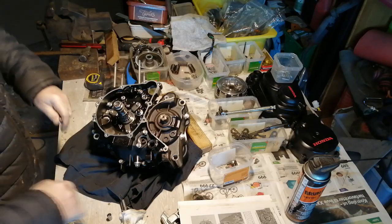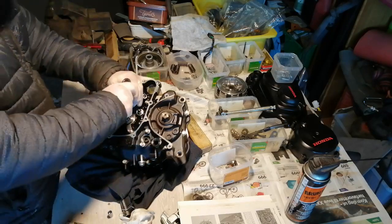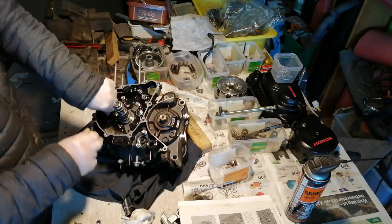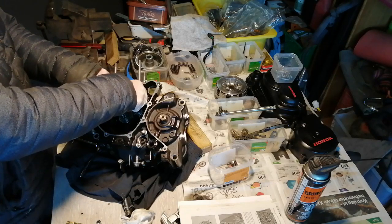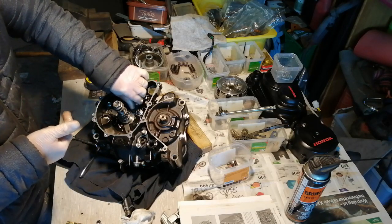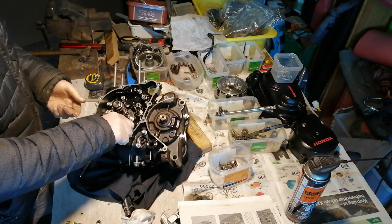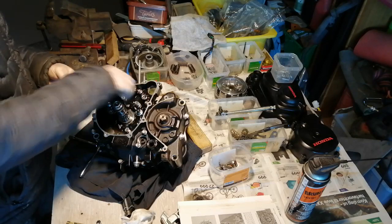I'm going to have to use the impact wrench just to make it easier. They say you shouldn't use too much impact tools where you've got steel fasteners going into aluminium. There's always a risk that you can damage it because aluminium is way softer than steel, but if you're careful you can probably get away with it. Definitely don't use impacts for assembling because you can strip threads. These retainers I think are all the same - I'm just going to pop the screws back in because it won't affect the casing or my cleaning.